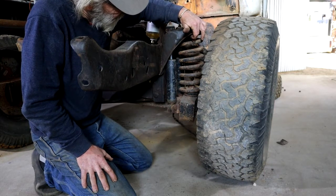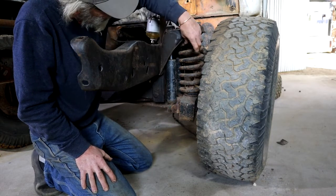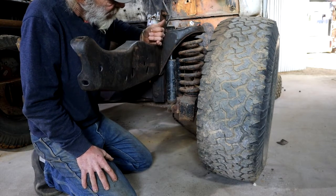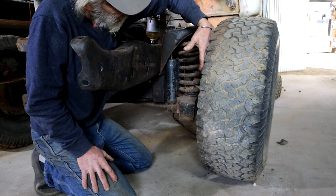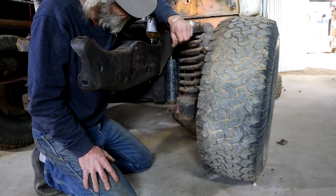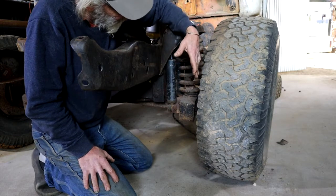There are going to be several implications, so we need to keep that in mind. Number one, if I shorten the coil spring, I will definitely drop, but because the spring is shorter there's less spring material, so the front suspension will become stiffer. Unless I get a new spring made, there's not much I can do about it. The other implication is the business of camber. You can probably see that currently we've got the wheels standing in positive camber — that makes sense because of all the weight — engine and transmission — that's out of the car at the moment.